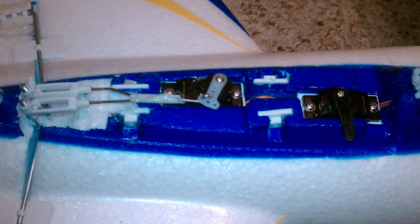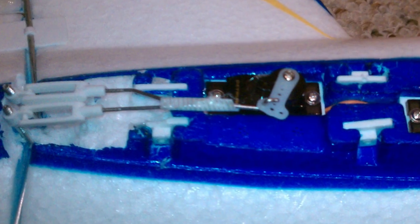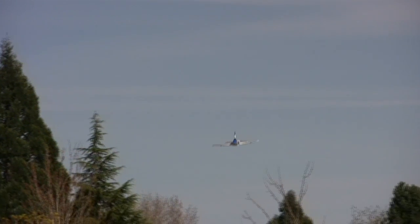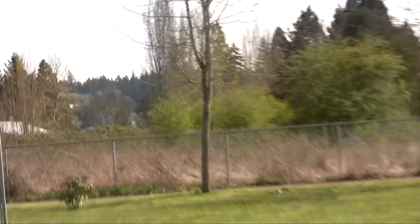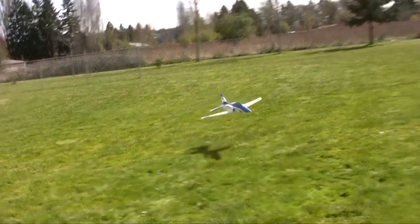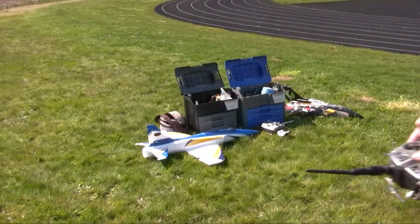The elevator — that's where there's some trouble. There's some wacky hardware going on with the elevator, which is inside the rudder housing. The elevator angles down and one servo is trying to move them both. That's where your fuss time is going to be. It's also tricky to land because this airfoil is so efficient and the plane flies so fast — it was hard to circle it around and land it close because it just keeps gliding forever.